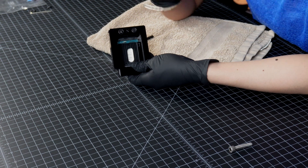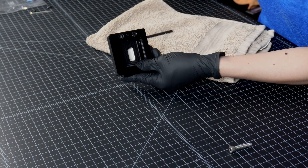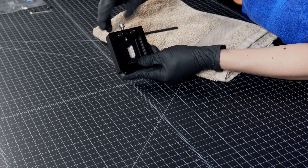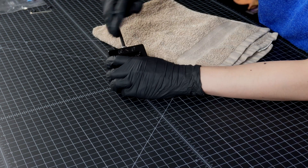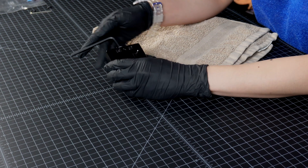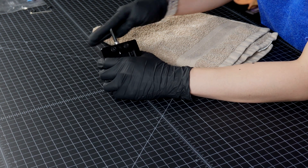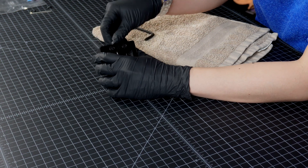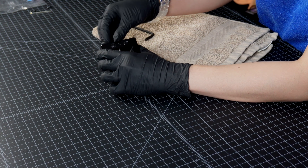You want to quadruple check that. Slid that in perfectly and now we're going to essentially move the IHS — the lid of the CPU — back and forth, loosening it up. Look how easy it is, and that's because we've already loosened it up. Now we're just going to do this a couple more times. Make sure there isn't that much resistance. If you can feel resistance, make sure you guys aren't threading your CPU.